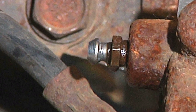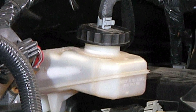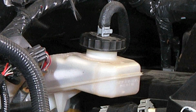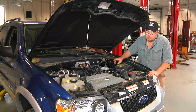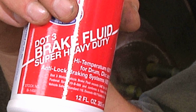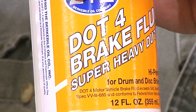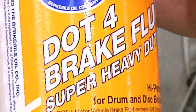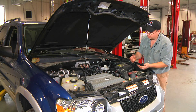After the fluid is coming out of the bleeders nice and clean, we close all the bleeders and then make sure that the reservoir is full under the hood of the car. When renewing the fluid in any brake system, along with an ABS brake system, this is our reservoir. We want to be specific about the fluid we use. The top of this brake reservoir tells me to look in the manual, which I did, and it says I can use DOT 3 or any equivalent fluid, which would mean I could use 3 or 4. It's important that the cap stay on the reservoir as long as possible — if this cap is left off for too long, the brake fluid has the ability to capture moisture out of the air and will diminish the efficiency of the fluid.